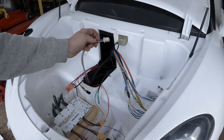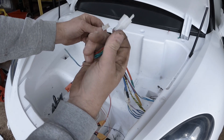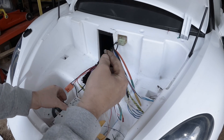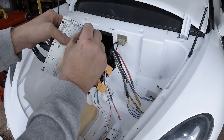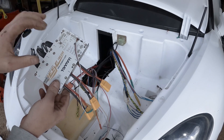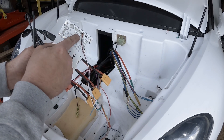For the reverse switch, I connected two wires on the reverse switch on the car. I cut the old plug from the stock controller and connected it to a 3-pin JST that will connect to the PPM port on the VESC. This VESC has Bluetooth integrated, so we will use the servo signal for the reverse switch.